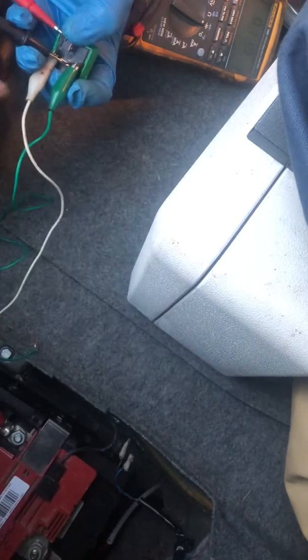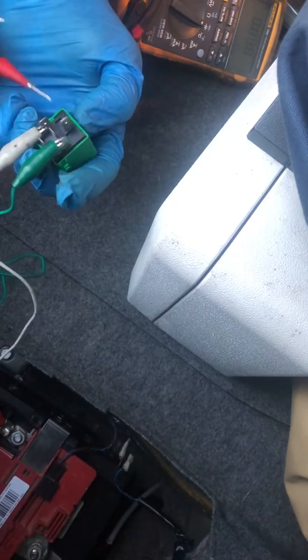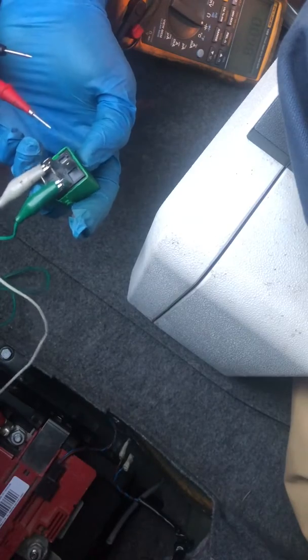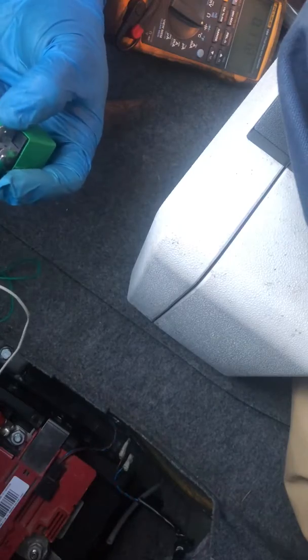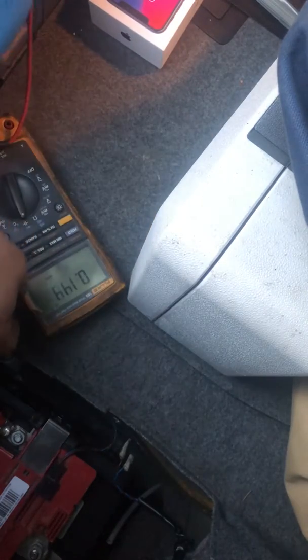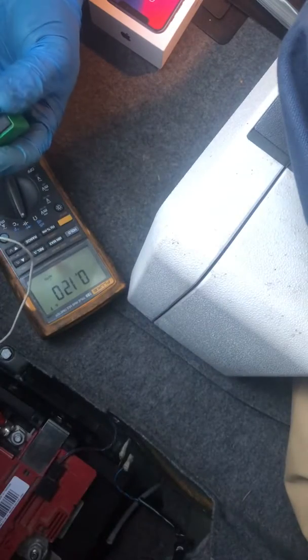Okay, so there you go. Between 30 and 87A, there's actually a diode, which is pretty much a one-way path for electricity. We can either go one way but not the other. When we power this up, we get a slight amount of voltage allowed to pass through from the tester through and into 87A. It's showing a diode function there, so right now we have a base reading.